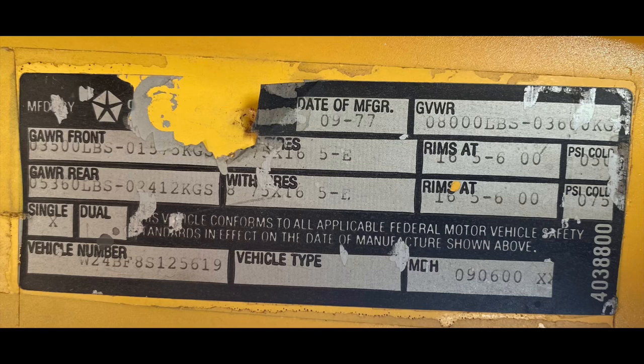It's obvious I need a brake master cylinder, but which one do I need? If you go online and look, they're going to give you two options. Open up the driver's side door and look at the placard — it's going to call out what size front axle you have, either a 3,500-pound or a 4,500-pound. The 3,500-pound is typically a Dana 44, found on a three-quarter-ton Dodge. The Dana 60, which is normally in the rear of a three-quarter ton, could be in the front of a one-ton Dodge like a W300 or D300. That 4,500-pound axle versus the 3,500-pound is what you match up at Advance, O'Reilly, NAPA, or whatever — it tells you which master cylinder you need. I'll put in the description which one was correct for the 3,500-pound axle, which is most likely what you're looking at.